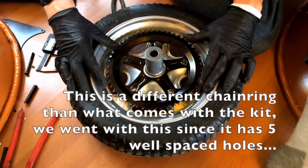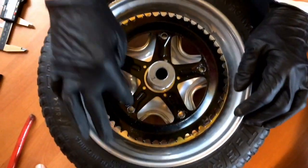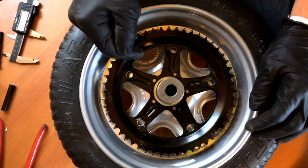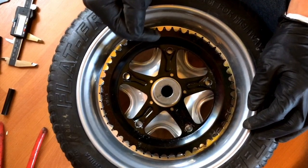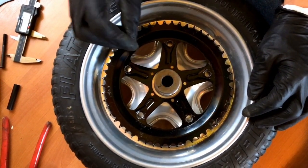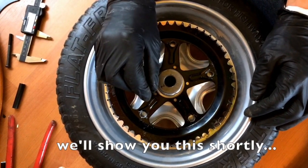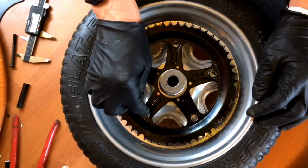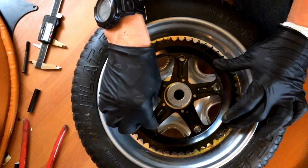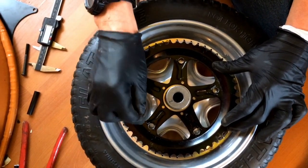To mark the holes, I line it up visually so it's just perfect right here. Then we're going to mark each of the five points and take a nail and a hammer and dent it in. Then you want to go through a process of drilling a number of different holes sequentially in larger sizes — start with about an eighth-inch hole to make sure it lines up with the dent, and then go bigger and bigger. We don't want the holes initially to be any bigger than the holes drilled into the chain ring, which is just wide enough for the bolt.